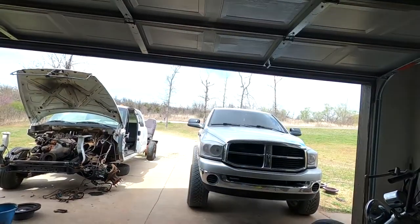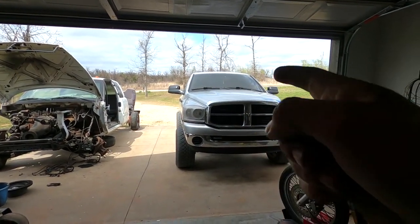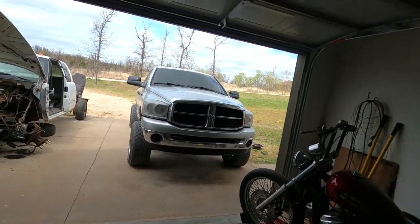Okay, guys, it's the next day. We got a new brake bleeder. We got a new banjo bolt for one of the rear calipers because one of them was a little messed up, and I ended up having to run the old washer that was still on it because I could not get the washer off because of the way the bolt is, which I'll show to you. But we got us a new banjo for that. All the rest of them, I double checked, everything looks good so far. So let's get that tossed on, and I'll show y'all what's wrong with it.